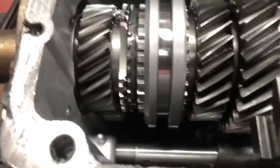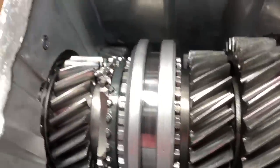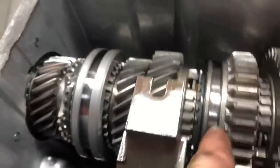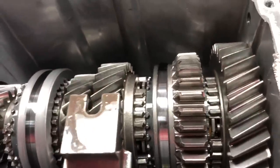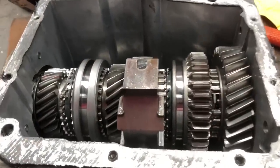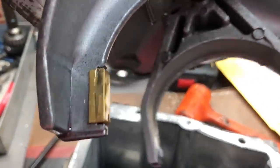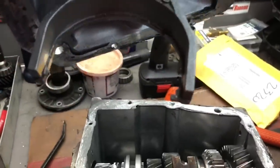Here is the insides - there's a piece of clutch fork right there. Everything looks okay, there's probably a bunch of metal at the bottom of the case, but all the gears are fine. There's a little mark here and that's probably from chewing on the clutch fork - that is fantastic. Blew a third gear clutch fork apart, transmission's fine. You can see the wear on that brass pad - that baby's been getting hammered. Been getting a workout, but that third gear fork definitely got worked right out of a job.